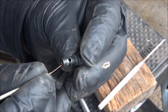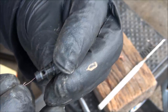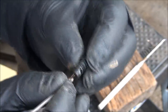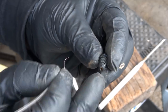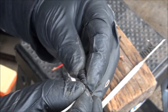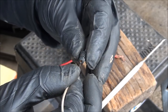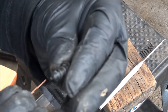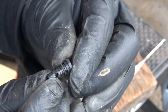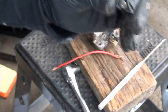To get out your slow jet you will have to remove your idle screw — just look to see how far it's poking out the other end so you know how far to screw it back in when going back together. This component is very fragile so be very careful — it basically just pushes in and pops out, but it's very easy to break, and there are very small o-rings on here that you want to be careful not to damage. I would not recommend spraying carburetor cleaner on this because it can destroy those tiny little o-rings. There's a passageway up through the middle of this jet that needs to be cleared out — it's very very small, but if it's plugged it'll affect the way your engine starts and how it runs. This is the type of wire I use — it's copper so it won't scratch the brass jet. The hole is so small you can barely see it with the naked eye. I finally got this to poke through — nice and cleared out.